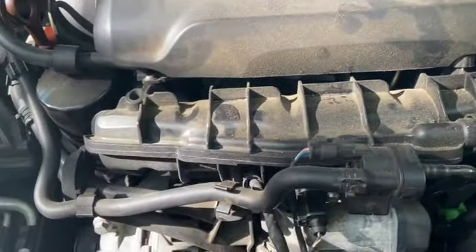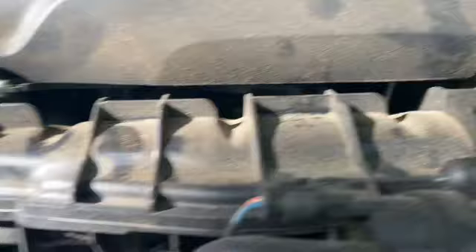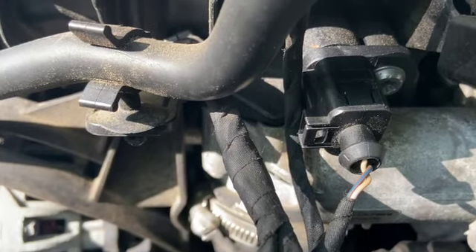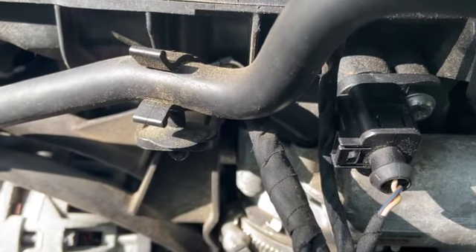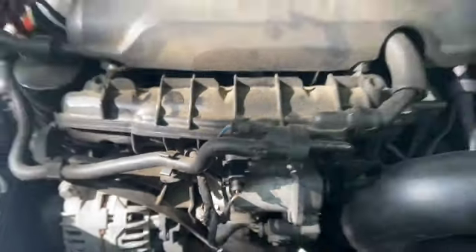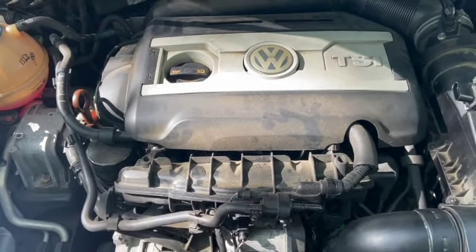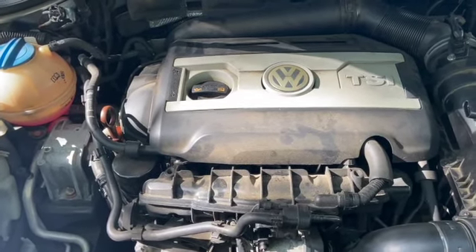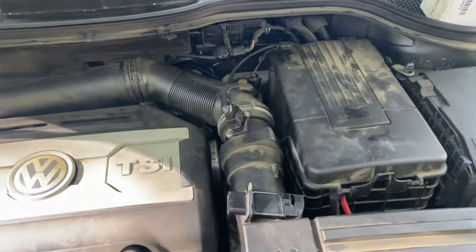In my car I had another sensor that looked like a mass airflow sensor and went directly into my intake manifold, but it did not meet the criteria — as you can see, it only has two wires, not four, five, or six. So I knew it was not the mass airflow sensor. After investigation I found it was the air charge temperature sensor. Yours may or may not have that sensor. I cleaned that using electronics cleaner, which is safe for most sensors. Your throttle body uses throttle body cleaner, but use only mass airflow cleaner for your mass airflow — it is a very critical component.